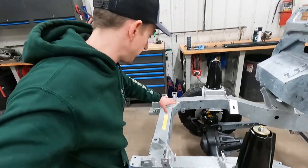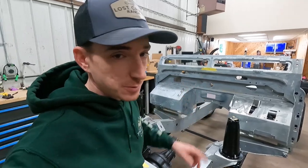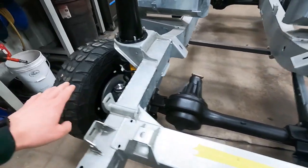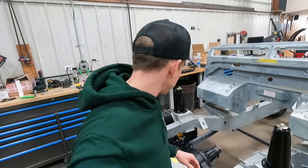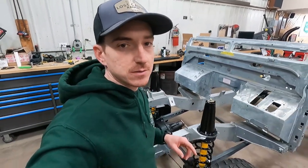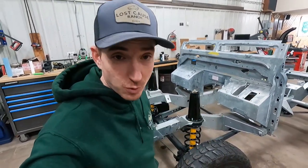We have to line up our steering bits here. That donor was a right-hand drive one, and this is left-hand drive — we're in the US, so that's a little more convenient. That's part of the reason why we just used a donor set of Discovery axles, so we have the correct left-hand drive spindles — knuckles, whatever you want to call them. But that leaves us needing a left-hand drive steering gear, so we'll have to get that. Then it'll not just roll — it'll actually turn.